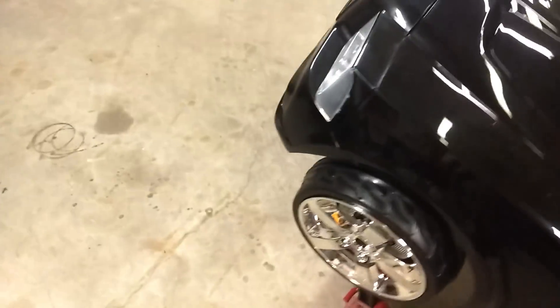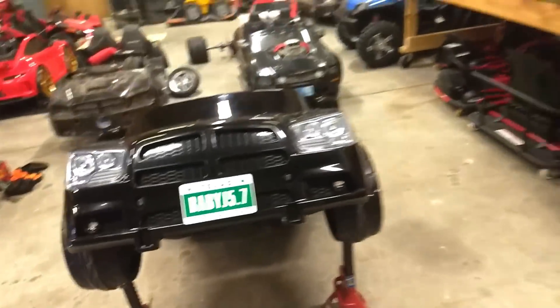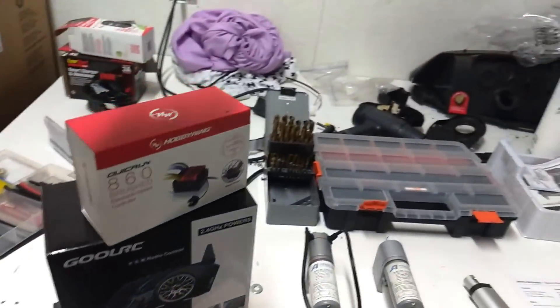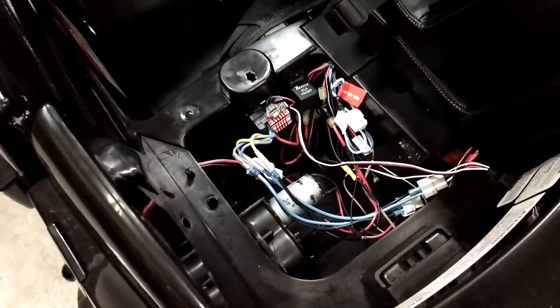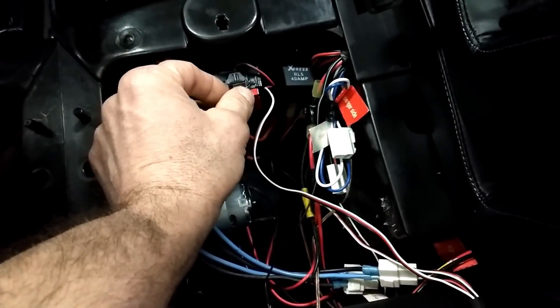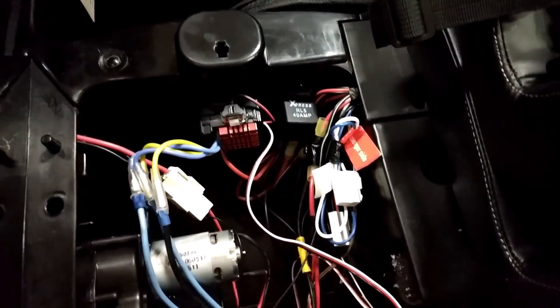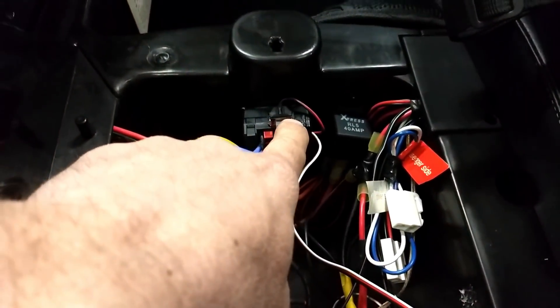We've got velcro on the LAC board so we can tuck it out of the way — that's where all five wires go. It's a tiny little unit. In the description I'm going to leave all the links to the actuator, the control board, the radio system, and the ESC — all found on Amazon. As for the ESC, it has an on/off switch; we left it in the on position because it doesn't see power until this relay, which is wired into the key. If you don't have it wired into a keyed ignition, you'll want the on/off switch accessible so you can turn on the speed controller after you turn on your radio.